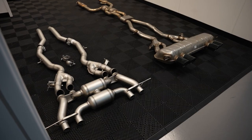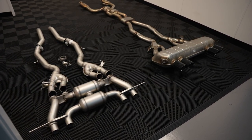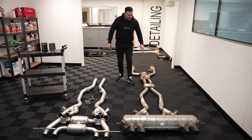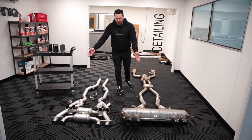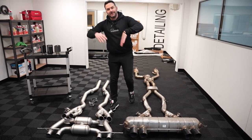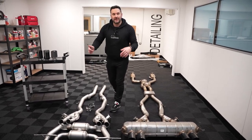What we're going to do first of all on our car, we're actually going to start with OPF back. I'll show you where that is — if Jay can pan down now. Factory exhaust system, Remus. You can see the size difference in the silencers. You can see how the valve system works on the back. We're actually going to be doing from here back. Those are your two OPF filters. We'll remove that centre silencer, move that whopping big unit of a thing and replace it with this. When the valve is open it will bypass the box. The valve on the standard one goes into it and has these two sort of resonators in the back just to bring it down. When you're in efficient mode or have the valve closed, it will run through the box, and when it's open, it will run through the box and on the outside as well.